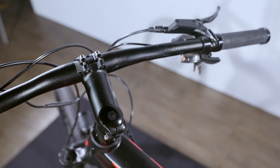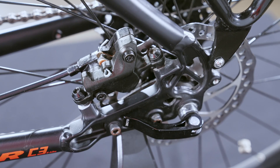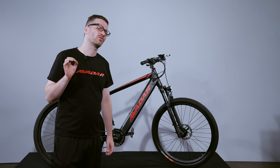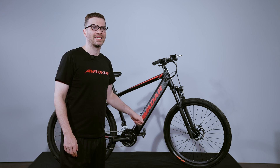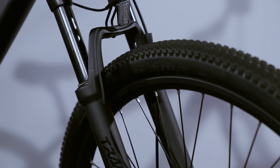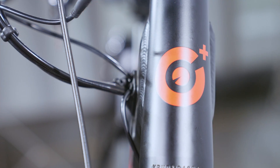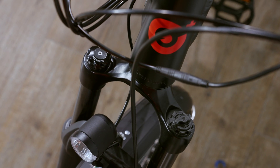Now let's take another look at an important part of our hardtail setup: the braking system. The Avidar C3 is equipped with high quality hydraulic brakes designed for high braking performance in a variety of riding styles. The most important advantage of hydraulic disc brakes is that they automatically readjust as they wear. The caliper design retracts a certain distance from the rotor regardless of the amount of pad wear — there's no need to readjust the brakes as with mechanical pads. Hydraulic disc brakes provide full stopping power in all weather conditions and offer maximum control on rough technical terrain.